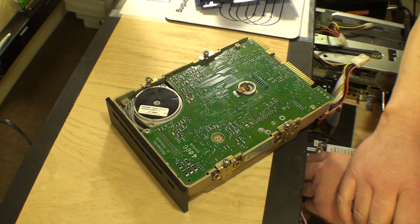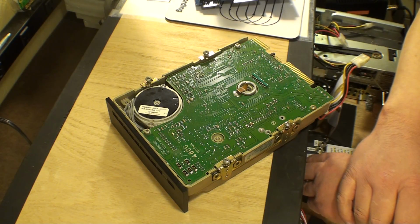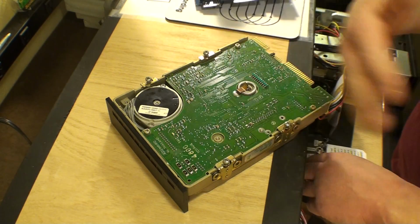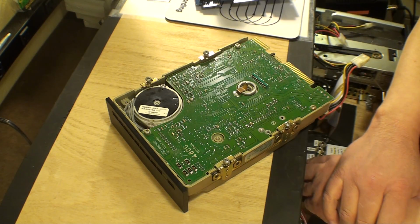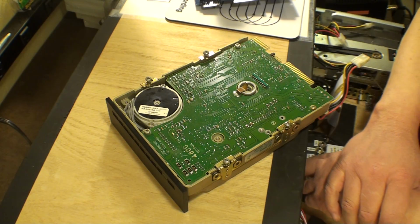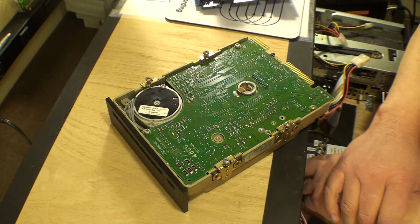It's almost like when it goes into position, I hear the motor, I hear the platters slow down some while it's doing that. So it's almost like it's getting some resistance over the platters, and that's, well, that's not a good thing. So we won't be doing that anymore. Okay, well, that's somewhat disappointing that this thing doesn't just hum right up. I'll have to give that some thought.